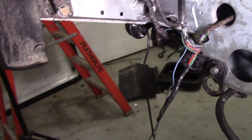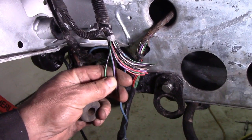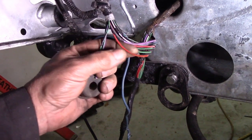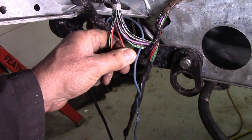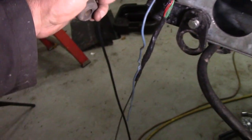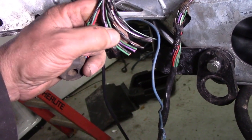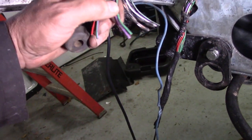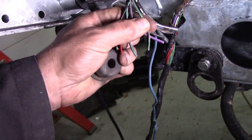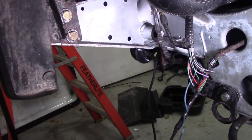Let's get on with wiring. If you just follow the regular colour codes — green and purple for brake lights I think. There's a left and right night light — a parking light, should I say. A red with an orange, and a red with a black. Green and a black I think that's a fuel tank. There's a twisted pair — those must be the speakers. Green and a red is the left. And green and a white is the right — that's how you remember it: green and a white is the right. And that's on Minis, Triumphs, all sorts of British cars. All we've got to do now is work out the colour code of the position of the wires on that pre-wired plug.